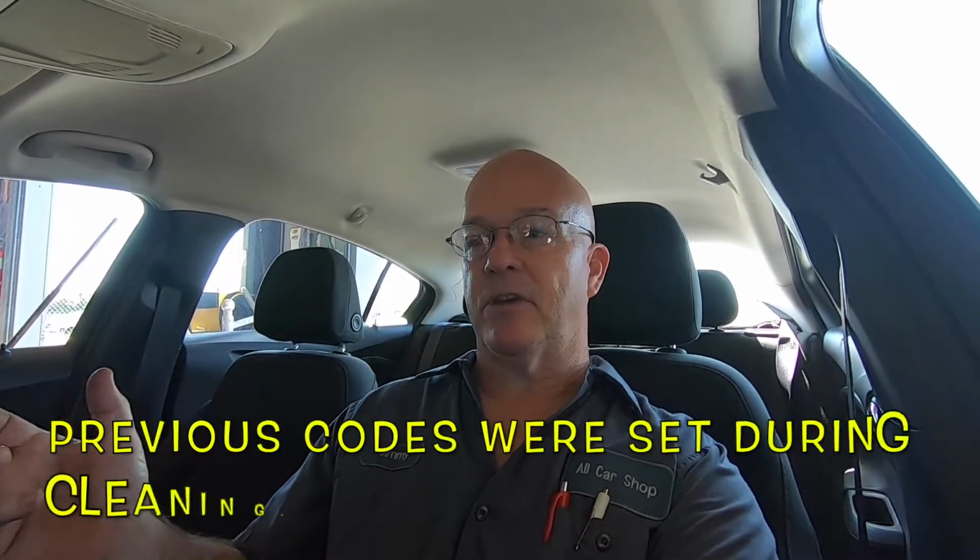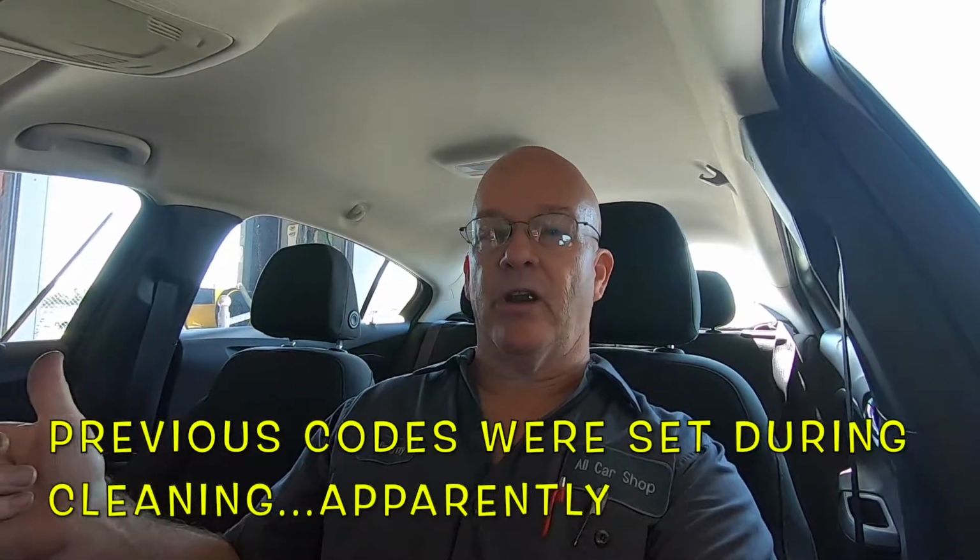What they're doing, all these manufacturers doing the same thing, they're making it really difficult to modify your car. So that system is super sensitive to airflow. So if you put an aftermarket air filter in there, it'll set this code. But the throttle angles will be below 8 to 12% because it's trying to reduce the airflow, and it'll set the same code. If the airflow is low, then it sets the code because it's opening the throttle more than 8 to 12%. So it gets real angry about that. So something to make a note of.